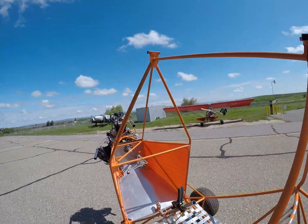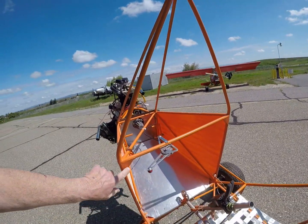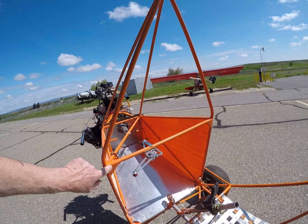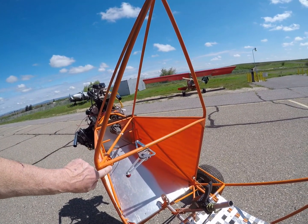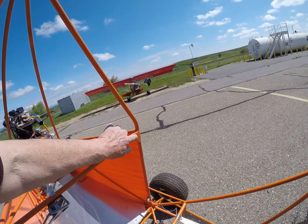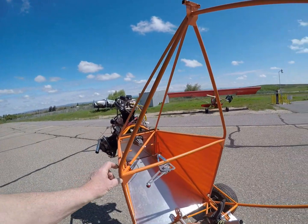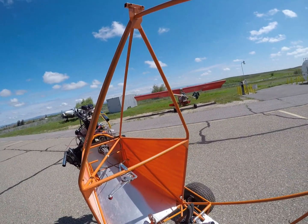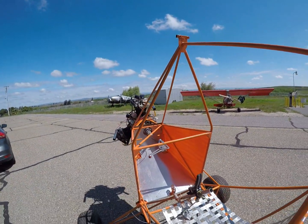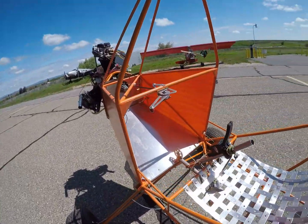The front of this also very gently wiggled — not very much, but enough to notice. I put a little plate on each side — this is 0.032, about an inch and a quarter wide — and welded it in. What that does is keep any of that from moving; it moves as an assembly now rather than wiggling and flopping around.